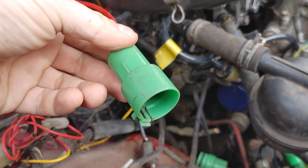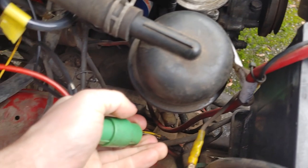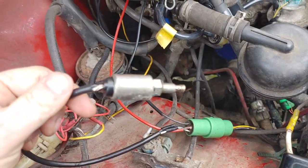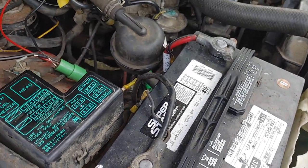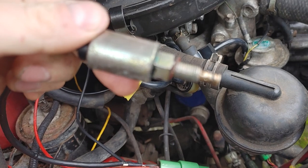It's pretty much everything associated with this whole thing — new carburetor, all that stuff. On the wiring side, we've got this green harness here. Let me just plug this back in because we're gonna try to start it in a second. Okay, plugged in. This fuel cut solenoid is definitely dead — hacked into the wiring harness and hooked it directly up to the battery, which is measuring just over 13 volts. No click, nothing at all.